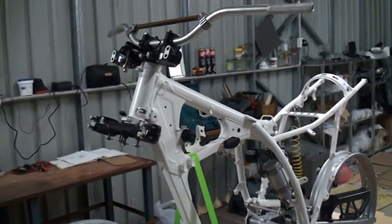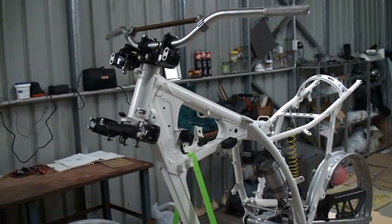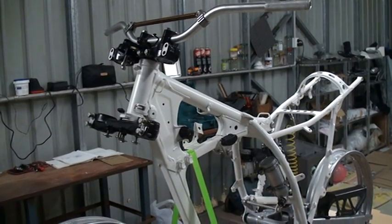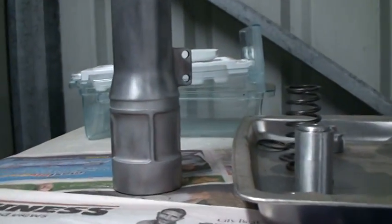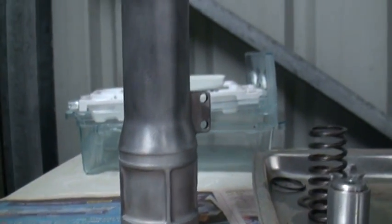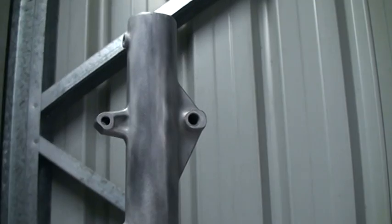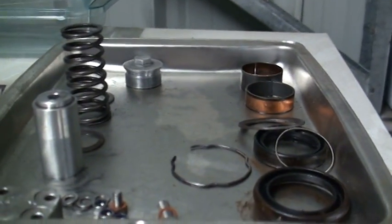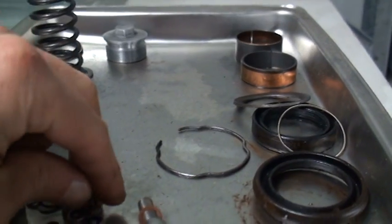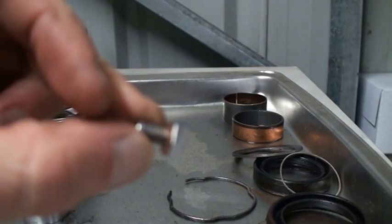I have to replace the bushings and the dust seal and the oil seal, plus put in new backup washers. One of my shocks is over here right now along with all my front forks. I sanded it down, still have to sand it a bit more and then coat it. These are all the loose bits and pieces that I'm going to replace on the right side, and of course the bolts from the fork I replaced with stainless steel, plus a couple of washers.